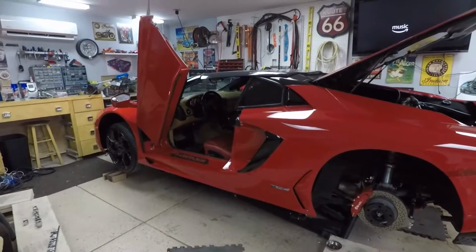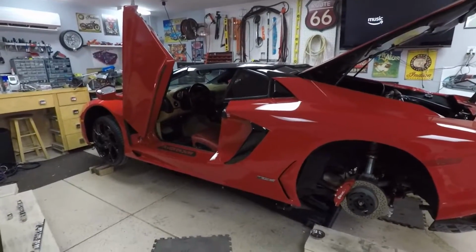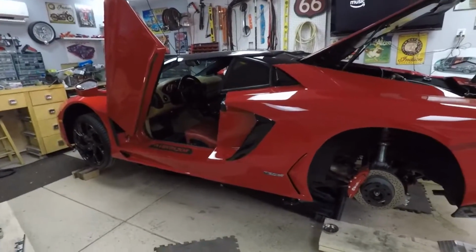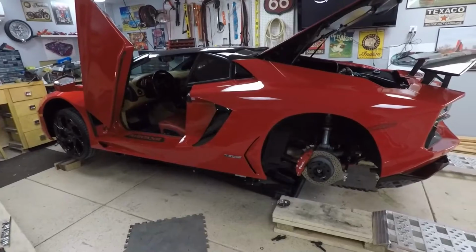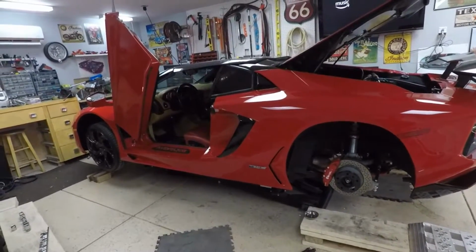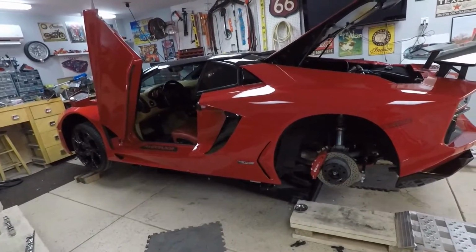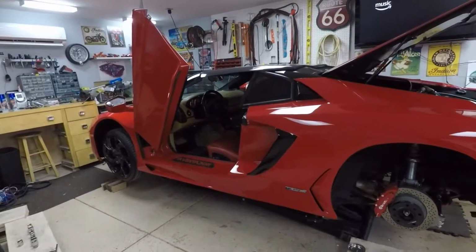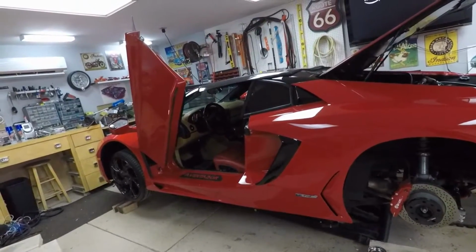Mine had a minor leak and a major leak. Well, obviously, if you have a major leak, you're going to get the code for a minor leak too. It seemed like you'd get them back to back, and I always got those together for that issue. Every time I reset it, both would come back, which kind of makes sense. So I think it wasn't opening properly, or it was stuck open sometimes or stuck closed all the time, and now it doesn't do any of that.